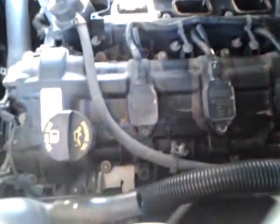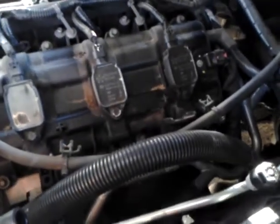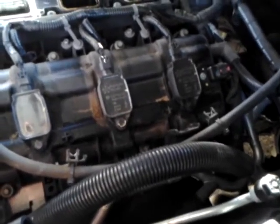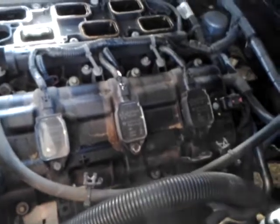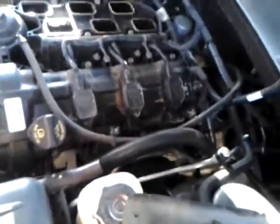Get a wrench. The front one, you have to have a wrench. You can't get anything in there. I tried, because it's going over top of the stud. The back one, you've got part of your AC lines running right in front of it. But you can get a deep well 13 millimeter 1/4 drive socket with just the ratchet. You can get it on there, loosen that one up. Loosen the nut up, leave it on there, about a couple three threads, and pull the bracket off.